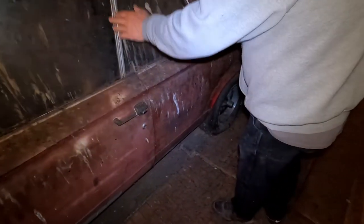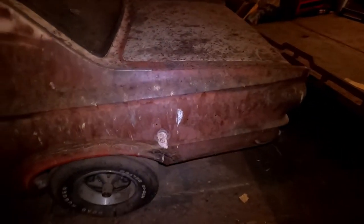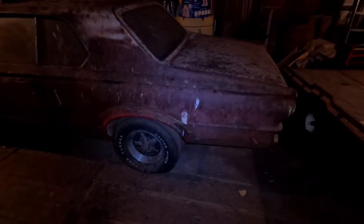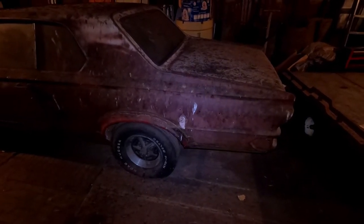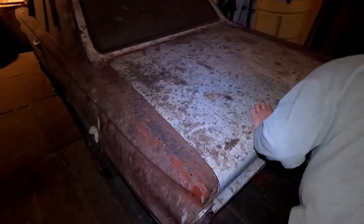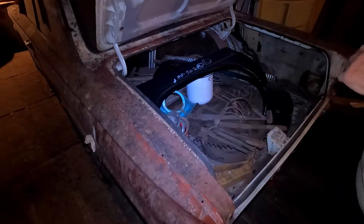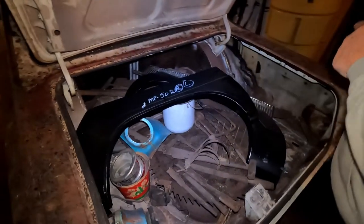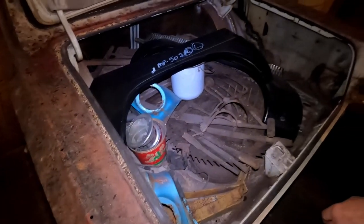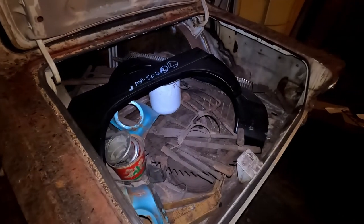The rear quarters I put on were off a Pontiac, but I got the original ones for it — they're in the trunk. So right now it's got Roadrunner wheels on it, but I have to narrow the rear end. It's tubbed and the springs have been moved in four inches already. I made the tubs for it — they're in there — and I moved the springs in.